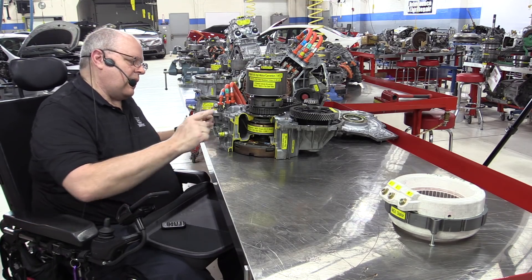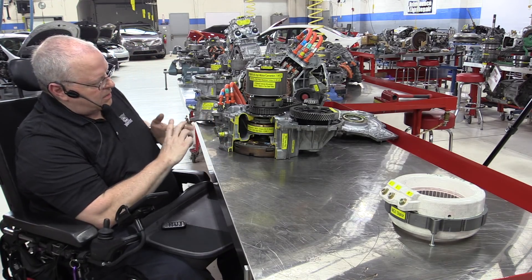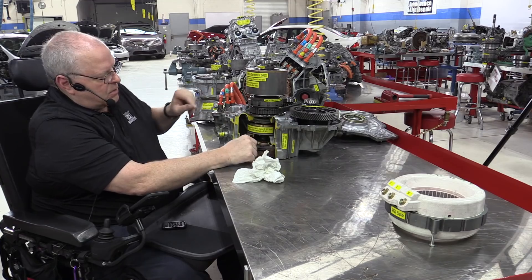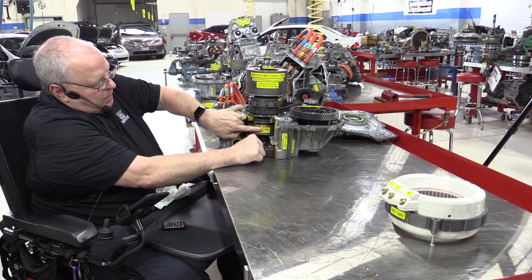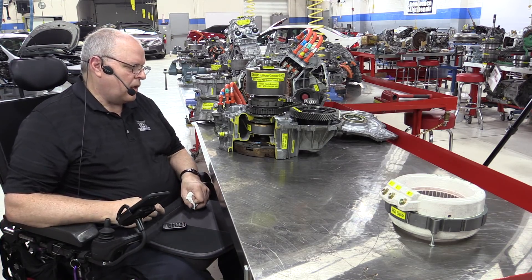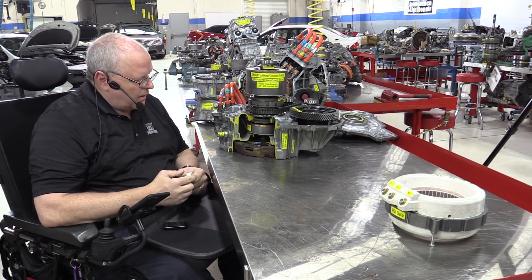What can happen is the internal combustion engine can have an effect on MG2's rotational torque if we control the rotational speed and direction of MG1. If I were to hold MG1 still — which we don't do in real driving — notice that causes MG2 to rotate. If I don't hold it still, it doesn't affect the rotational speed. So if we just let it drag a little bit, we can control how much torque we supply to help MG2 propel the vehicle down the road. At no time does the engine propel the vehicle by itself, and at no time does MG1 propel the vehicle. However, the new Prius Prime uses MG1 to help propel the vehicle, and that'll make sense when we get to that point.